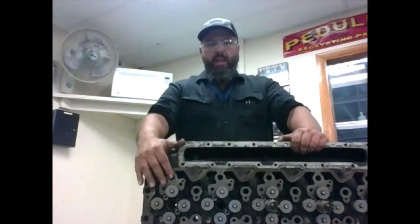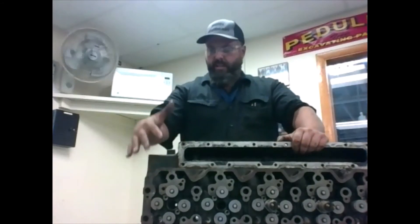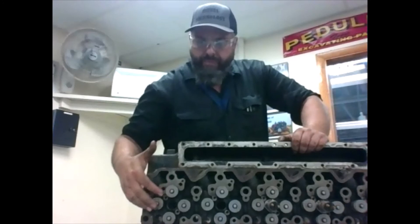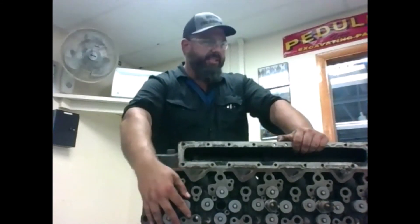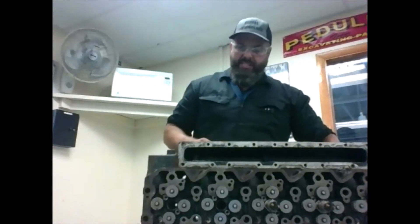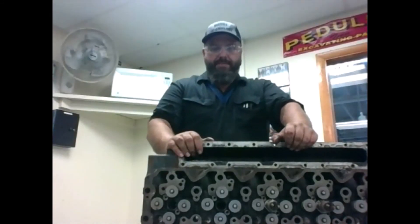That's all there is to it — it goes by pretty quick. The biggest thing is stay safe. Don't be pointing the springs towards anyone while taking them apart — always make sure they're towards a wall or something else. Make sure you keep track of the keepers, they're very easy to lose. Keep the valves in the correct order — this one's a little harder because we have two intake and two exhaust for each of the six cylinders, so 24 valves total. Use pieces of wood to keep track, or put tape on each one, lay them out, or just do one at a time. That's it — thanks for watching, guys. Stay safe out there.